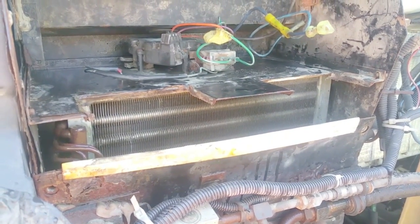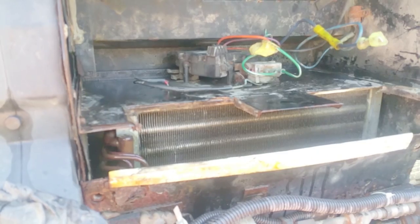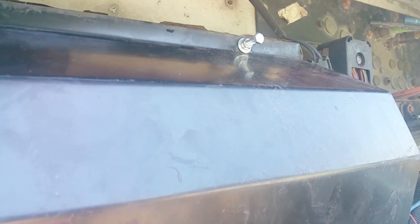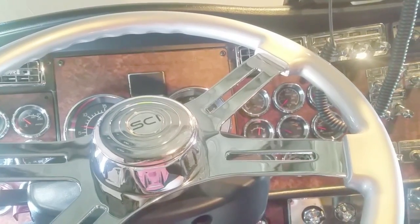What I've got going on right now is I just ran in one bolt — you can see I ran the bolt into the nutsert that's in the inside of the box, then used it like a stud and tightened down the nut and washer. Might be a little bit easier to take out in the future. The entire box needs to be replaced now that I've found all the leaking holes. I'm going to fire up the truck and make sure I've got the fan hooked up right.